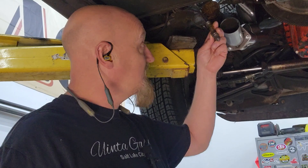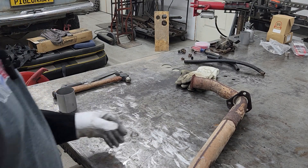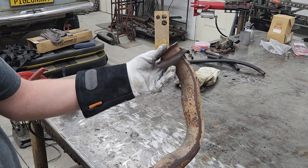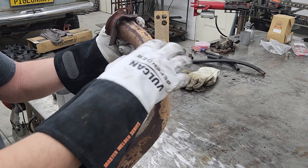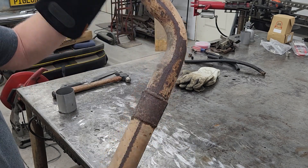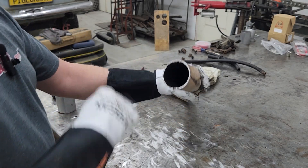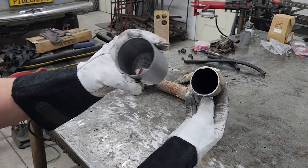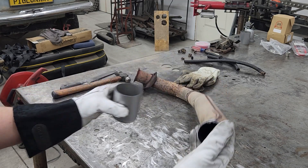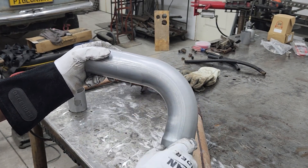We've obviously started the Fitech system — she runs! But she's not quite done being installed; we have one last thing to do and that's install our O2 sensor. I also want to show you why we're replacing the exhaust: this stock manifold pipe is pretty narrow here and it necks down really bad in the bend, plus it's got some pretty bad welds. We're going to be replacing all of this with this new pipe — look at the size difference. That's going to breathe way easier.